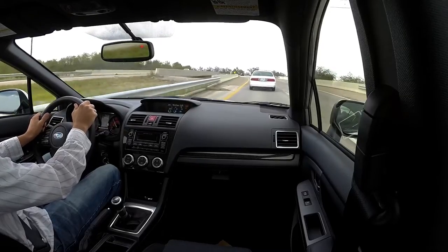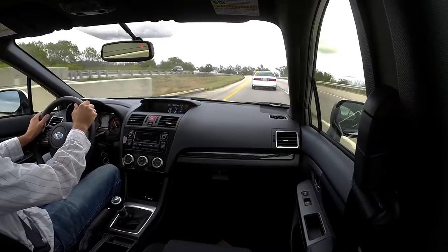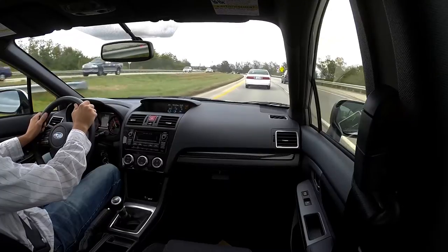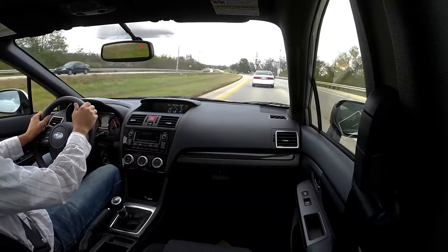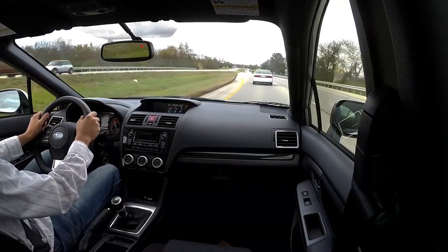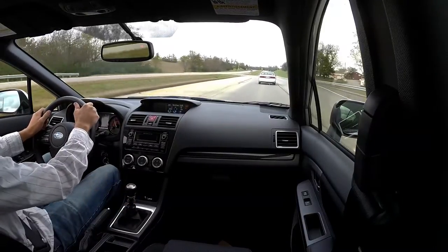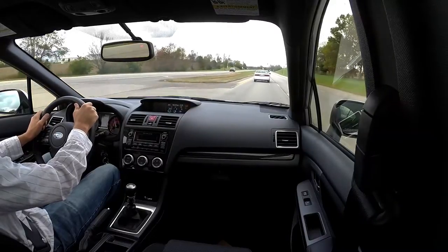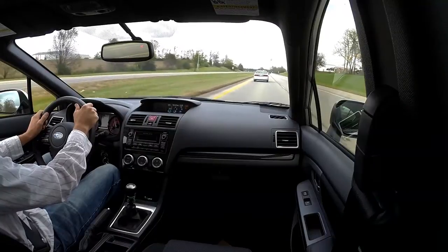The basic rule of thumb to prevent wear and tear on your clutch and components is you want to spend as little time as possible on that pedal. That doesn't mean throw it in gear and slip your foot off the side of the clutch — you do have to slip it a little. When you're first driving you'll slip it more; you don't quite know that point where the pedals match up to make it smooth, and that just comes from feel and experience.